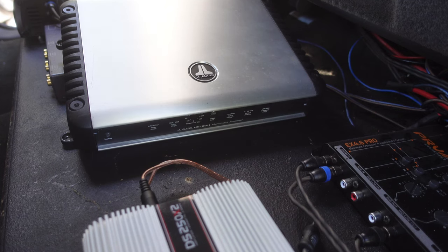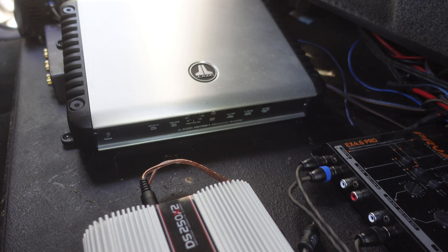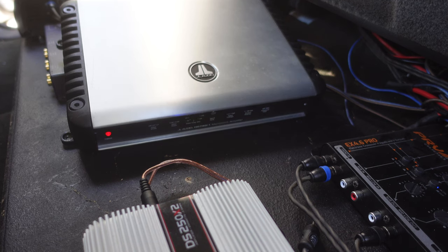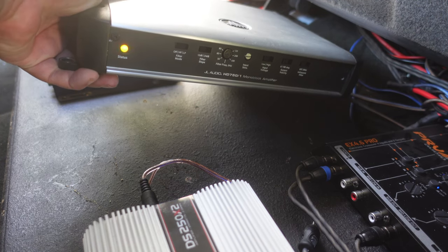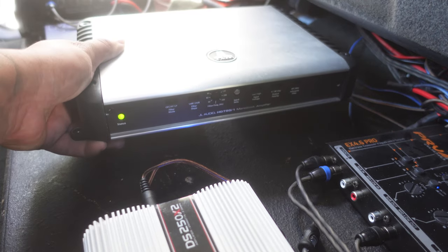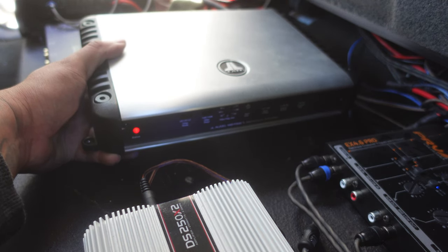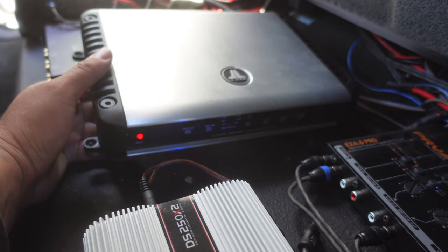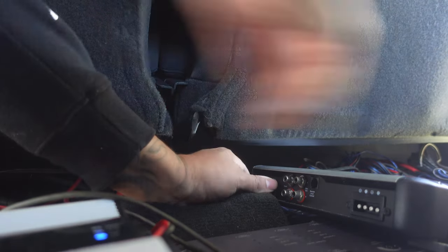The eights on the back make a big difference when they're playing — especially under a gas station roof with sound reflections. I'm going to turn on the power for the back amps now. It's flashing — it's going into protect. It's not doing anything useful, that's why I took it out. Very sad. Let's try connecting the other JL Audio amp and see what that does.